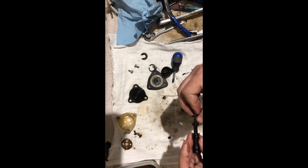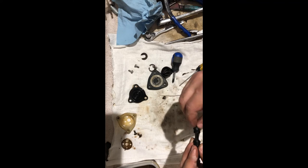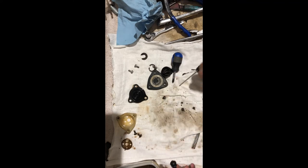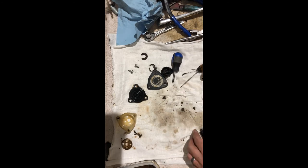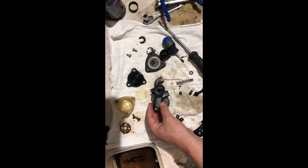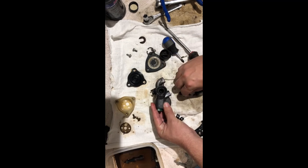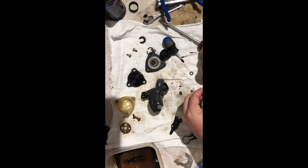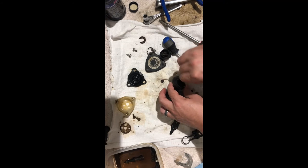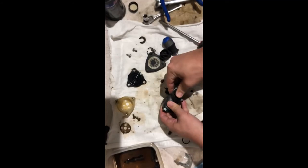Oops, put it on backwards — make sure that the cone is facing in so that that divot is back there so you can put this piece on it, like so. And then the spring, which will go in right here. Now that we've gotten everything cleaned out, we can go ahead and put the screen spring in. Remember to put the little cap right on the seal. I put a little bit of brake fluid on this so it'll go in a little easier. You get the first one in and then the second one you just wiggle it down. That's in.